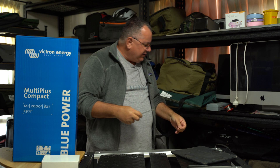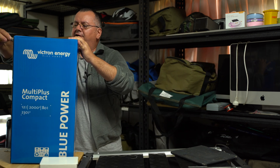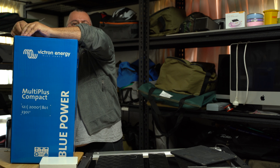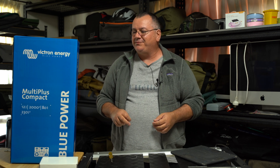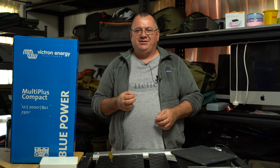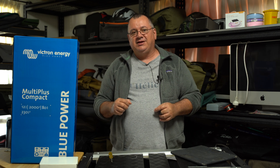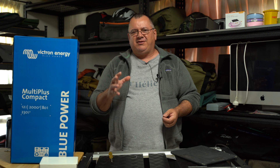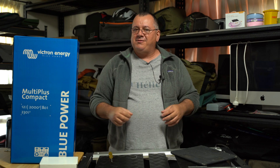While I'm pulling this apart, I can probably explain. Now that I've got the lithium battery set up in my vehicle and I've got the Cerbo GX, which allows me to retrieve data from all the Victron components — now that I've got the lithium battery, I needed a new AC charger. Even though I've got the ITEK World 120X lithium, which is a drop-in lithium battery, and ITEK World do claim that you can use a standard AGM charger to charge them, I want to stick to the right technology. I want a proper lithium charger to go with my lithium battery.